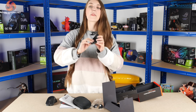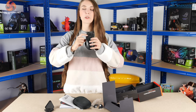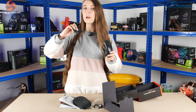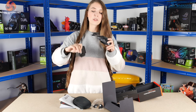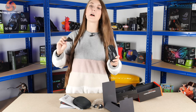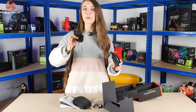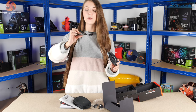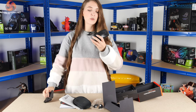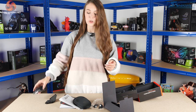This is the little kit that has the Omron switches in. This mouse uses Omron switches and ASUS have made them modular. The switches currently in the mouse are the lighter blue switches, and you also get a set of heavier silver Omron switches, so you can customize the mouse depending on what feel you want from the clicks. Also, if you have a problem with the Omron switches — there have been a few mice where they've died earlier than expected — they're easy to switch out. You've got a pair of tweezers, and also the option to remove the joystick and put in a blank filler.